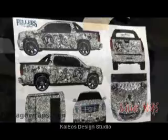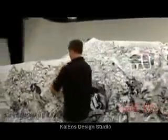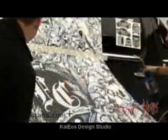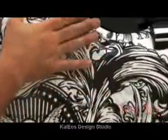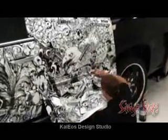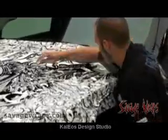After creating a layout map, your Fellers certified wrap provider will start installation by first taping up panels and registering them on the vehicle. When the taped up panels look right, the backing is peeled away and the process of squeegeeing down the vinyl begins. Seams are less noticeable if you have a busy design, as on this vehicle. However, you can also eliminate seams by creating printed panels to fit each panel of a vehicle. For example, you could have separate panels for fenders, doors, and hoods.